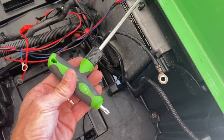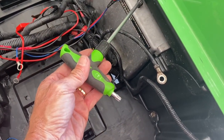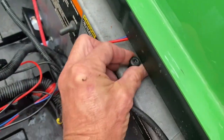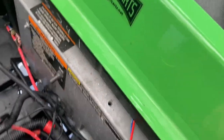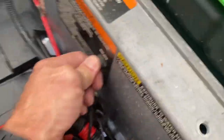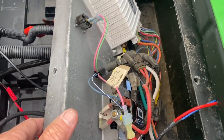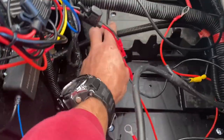I took this screw loose — it's not very tight, it's in plastic. That is a T40. Once you get the T40 loose, save all these bolts because you're going to need to reuse them. That wire goes to the Bluetooth radio but we're going to clean that up — just pull those out of the way. Good thing is there's no voltage. Here we go — that's where your controller, solenoid, and all your other stuff is.